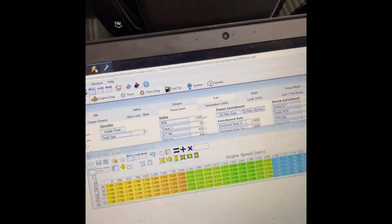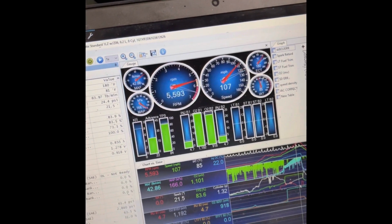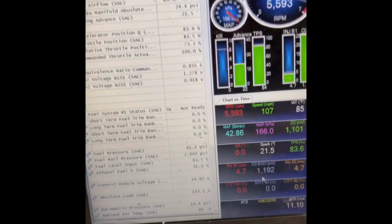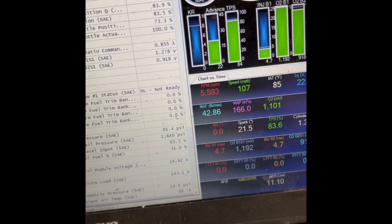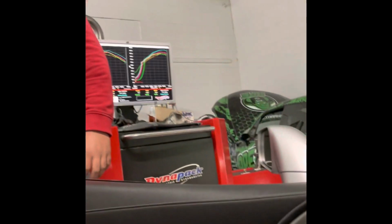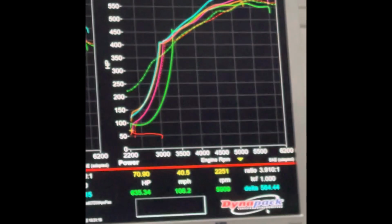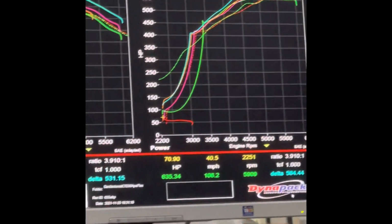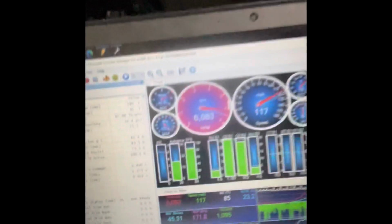If it's a gallon, just put like half a gallon in, because we only hit 21 degrees of timing, and the fuel was at E31. Went up to E36. Actually, just put barely a little bit more, because we're right at the limit of the fuel system, the 637 and 696. Yeah, it's right over a gallon. Okay, put half of it more, and we should be good there.